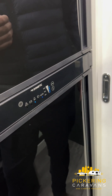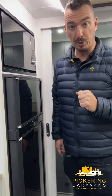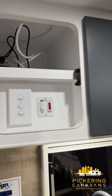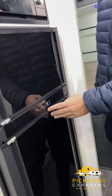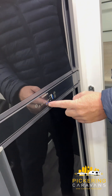The auto light means the fridge is in automatic mode and it will choose the most viable power source available. So what we'll do is go to our isolation cupboard and flick the fridge switch down — at the moment I do have this van plugged into 240 volts. We flick that fridge switch down and the fridge may take a moment to process, but it's going to pick up that we've got 240 volt power available and turn itself to 240 volts. That's why we advise leaving it on automatic mode.